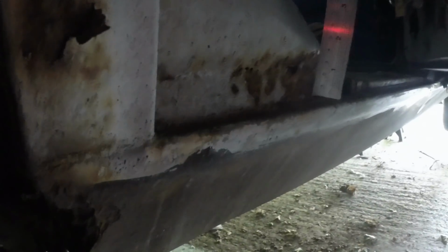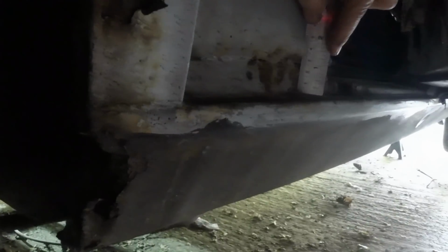We are now at the far side of the car, which I haven't visited for quite a while. It struck me that I can get the height of this panel from this side, although it's a bit frilly and it will need to be chopped off later. You can see that from the bottom of that seam to the kind of indent is about 25 millimeters, near as damn it. So I've marked on here 25, oh sorry, the curvature that I think I've got. Then I'm going to scribe a line at 25 all the way along, and then before I chop it I will still eyeball it and see what that looks like, but I think we're not going to be too far off if I use that approach.